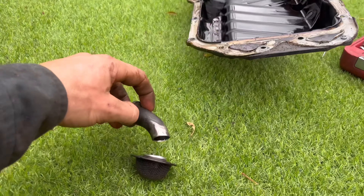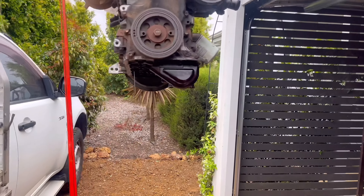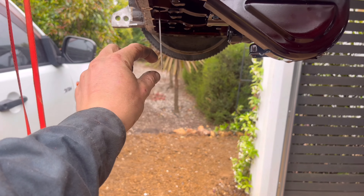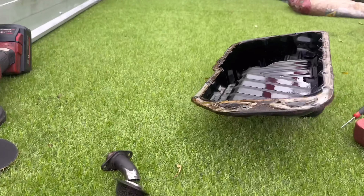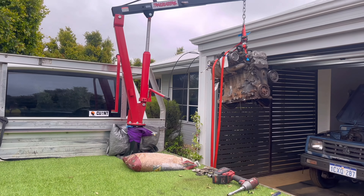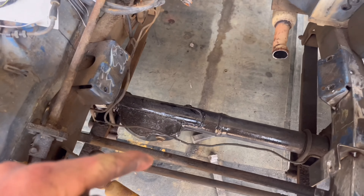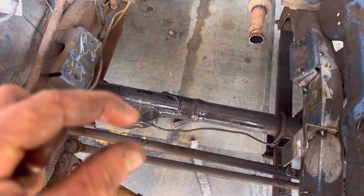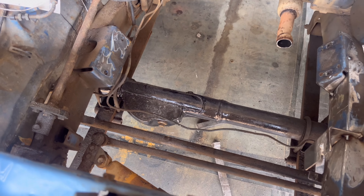Everything all the pickup was here, and this is the low side — even the dipstick will still have a little bit of play. First time for everything, a little bit daunting but I'm sure we'll get there, and hopefully it doesn't affect the oil pressure at all whilst running. The reasoning behind modifying this sump was rather than bottoming out on the bump stops, it would have bottomed out on my steering rods and diff. I only had about this much clearance, and with bounce, sag, and flex she was bound to hit the steering rods.